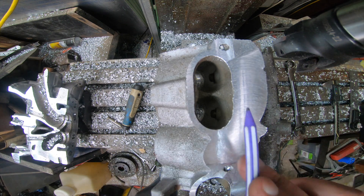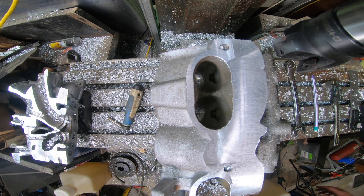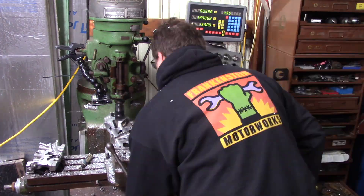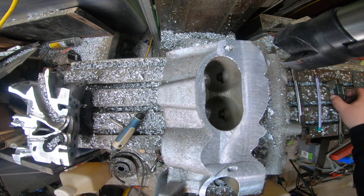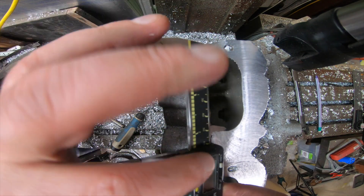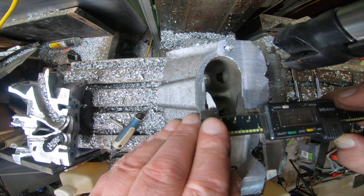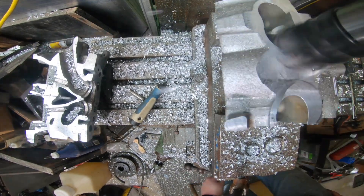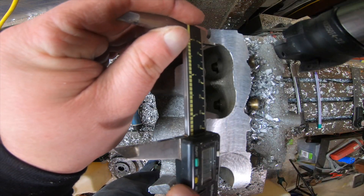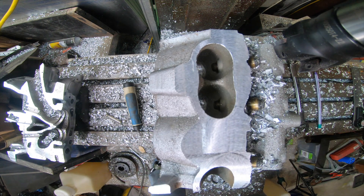It looks like we're starting to shrink vertically and expand horizontally — without doing the math it looks like it's very likely maintaining cross-sectional area. Another five millimeters and it's starting to come in, forming two distinct ports. Feels like we probably still maintain cross-sectional area. We're expanding by a couple millimeters. In the middle we're down to 27, but we're still almost at that 30 millimeters. Almost 63 millimeters wide, center's down to 25.7. Pretty sure that narrowed down slightly also — wasn't expected.